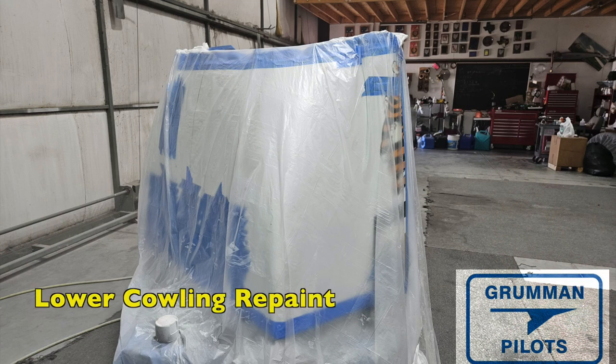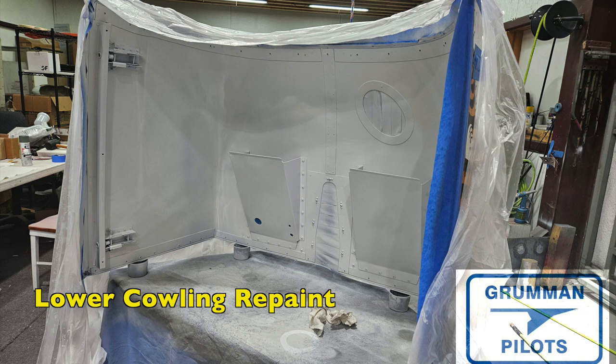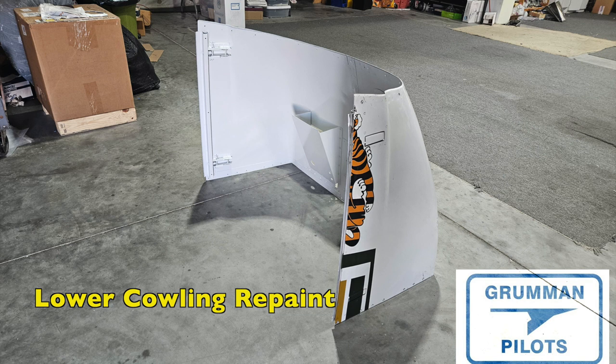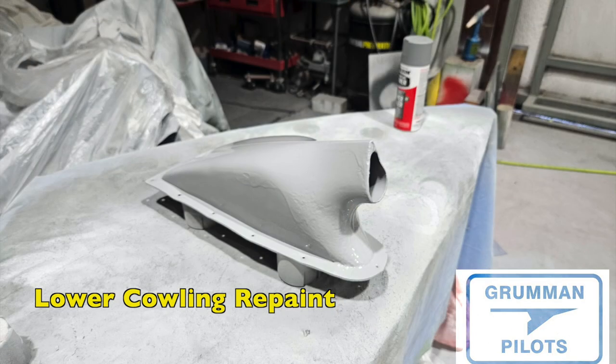We also took the fairing seal ring for the strut, cleaned it, primed it, and painted it. On the lower cowling interior — not the outside chips but the inside where the air exit ramps are — we're putting a good polyurethane white on the inside. This gives you a bright engine compartment so you can find dropped screws, and any oil or fuel leak will show up against the white. Blue fuel mist near a primer means a fuel leak; ash from an exhaust leak shows up nicely on the white Imron inside the cowling.